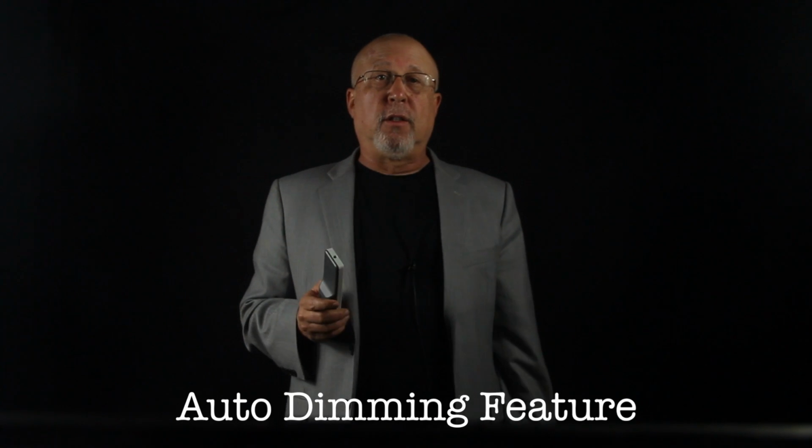Not only does this Sony projector have the ability to manage consistent brightness, even over years of time, and by the way, in part it does that by starting down 25% of maximum, but there are modes that start out dimming the projector 15% if there's no change in the content for a bit of time. And as that time gets longer than minutes, the projector will slowly dim all the way down to 5% brightness in less than a half an hour. That should keep the electric bill under control, even if you forget to turn the projector off and it's still hooked up to perhaps a PC, but nothing's changing on the PC image.